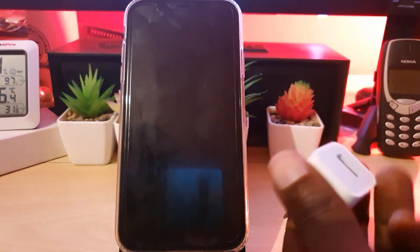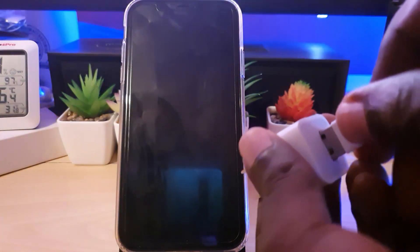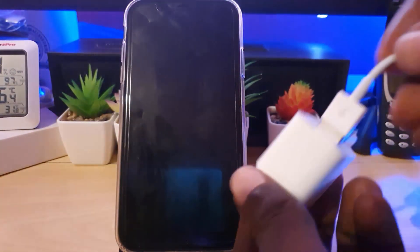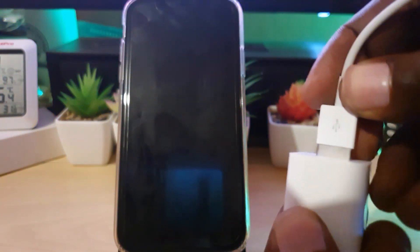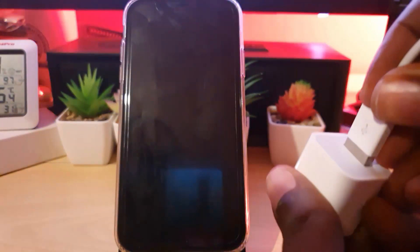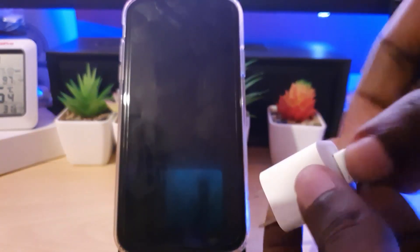In most cases I've found that it might be a case where you have not fully pushed the USB portion all the way in. If it's loose and you've barely got it in, it will not charge. So just make sure that it is fully flush — shove it all the way in. It might also be a good idea to remove it totally and then plug it in once more.